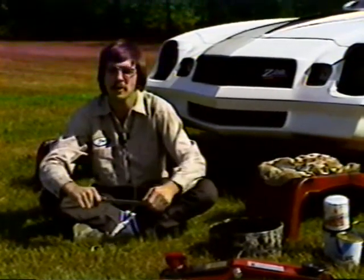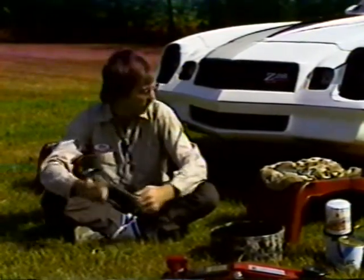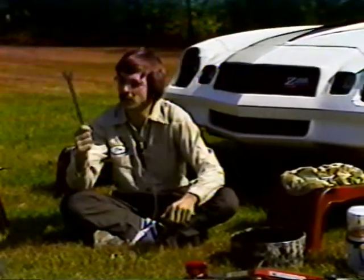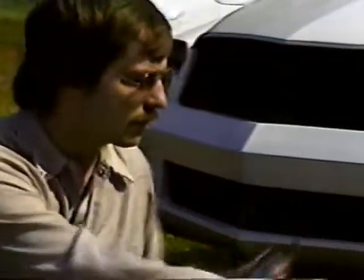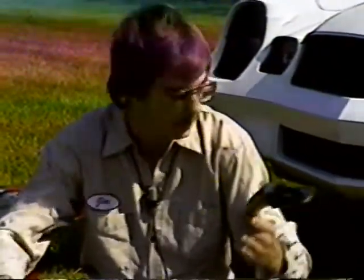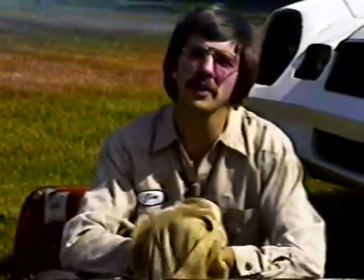That's a savings of about $6 or $7. You'll need an initial expense to buy a few minor tools — or you can borrow them. You'll need a wrench, a spout or funnel (I prefer a spout — it's cleaner and neater), and an oil filter wrench. You can get a wrench for a couple of bucks, a spout for a couple of bucks, and a filter wrench for a dollar and a quarter and up. It's also handy to have a pan to catch your oil in and a rag to wipe your hands.